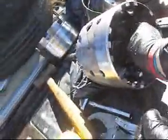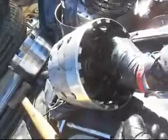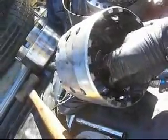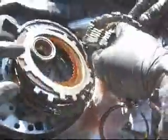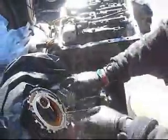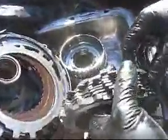Back in here, that's our input seal, that keeps getting lost, that goes back in there like that, thrust washer, that's right. It's a roller, man. It's a good quality part, no junk from China. The transmission's definitely been upgraded over here. One-way clutch, and people can put these in backwards, I've seen it done. No problem, it goes into reverse, four gears like a Corvair. Four gears reverse, one forward.